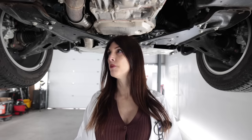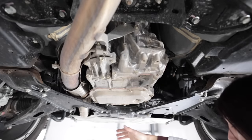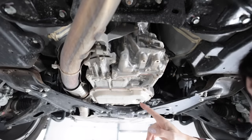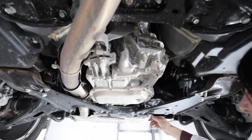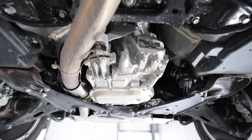Even though this is a properly longitudinally mounted configuration for the drivetrain, it has a 60/40 split, which means it's actually front-wheel-drive biased despite its drivetrain configuration. Thankfully Subaru put actual plastic down here for an off-road vehicle, which slides over rocks a little bit easier than felt-covered cardboard. But this transmission pan is just completely exposed — you've got this heavy-duty skid plate up front, but the pan is all exposed right there. There's already a twig under here and I haven't even taken it off-road yet.